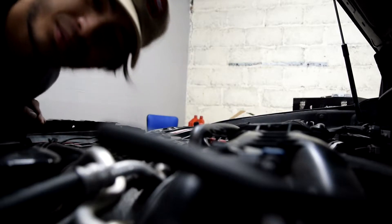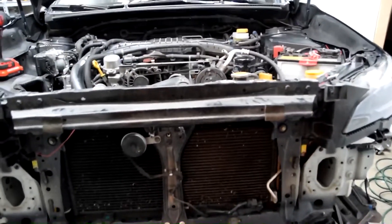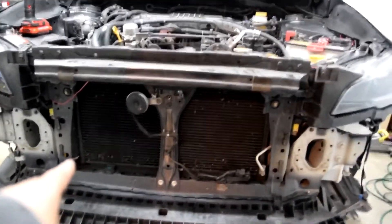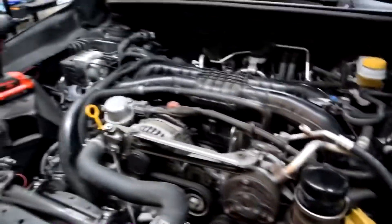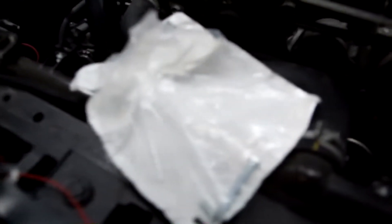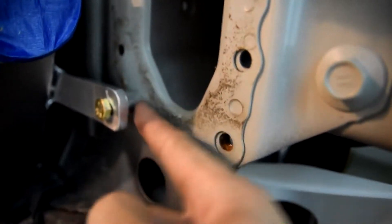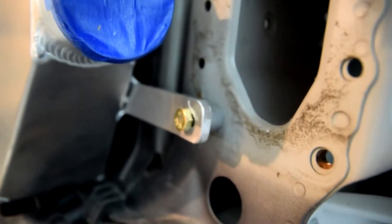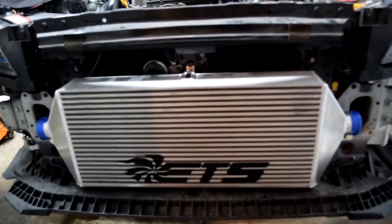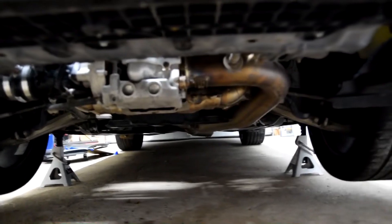There is literally so much work to do. After you get that crash beam off, we're going to start working on getting the front mount intercooler mounted to the front. I just got the front mount intercooler on — for you 2018 WRX guys with the facelift, let me know. I had to go to the hardware store because the supplied bolts didn't mount up to the OEM bumper bar, though I was still able to use the spacers. I also took off the splash guard and the skid tray.